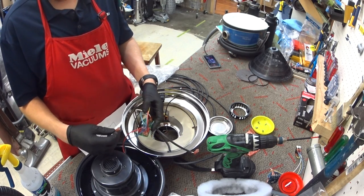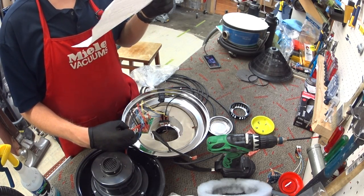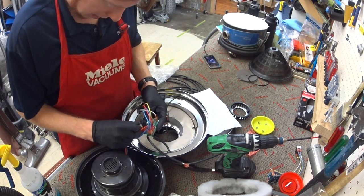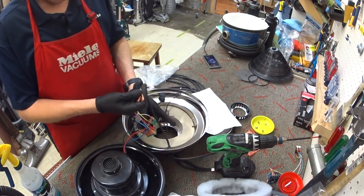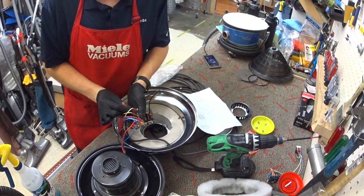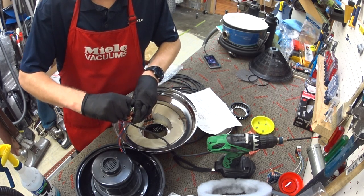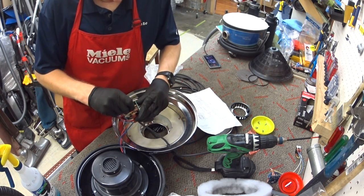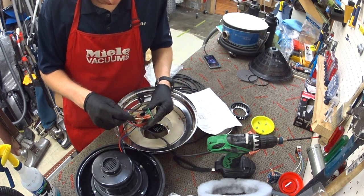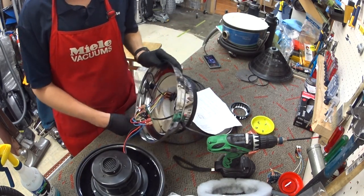All this for second speed that nobody is going to use. Well, this one says motor. I bet you that goes in there. Well, yeah, it sure does. So the cord is marked SW1 and line. Oh, and then there is a black so that you don't mix up the neutral and the black. Those are two different sizes, but the black and the white mark dot don't match up. That's kind of funny. Okay, so that's how we wire that.